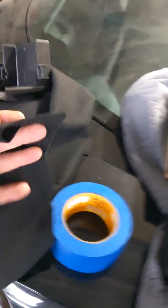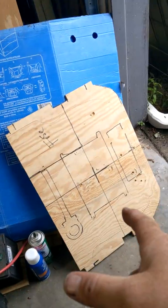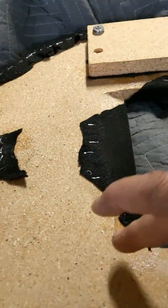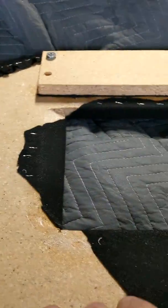The plate is just carpet — you get it from Hobby Lobby. I mean, you can do it in leopard skin or zebra or get stupid with it. As far as building this — my first time I built it out of plywood, but because of clearance and height it wasn't working out so the amp is flush. I measured my clearance and height here — both sides. Basically spray glue, pulled it over, stapled it, hammered it down, glued it, put the bottom piece on.